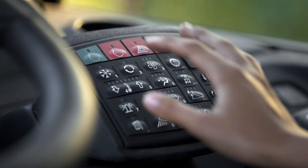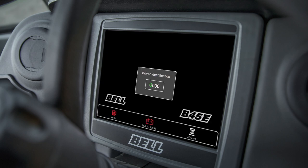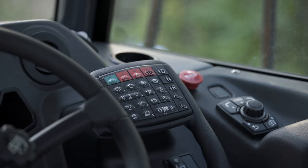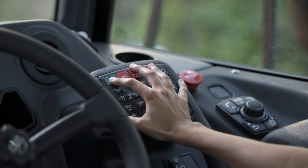To start, press the green button on the SSM. This wakes up the CDU. Enter the security code — the default setting is the last four digits of the VIN number, but up to eight personalized four-digit codes can be assigned to different operators. Press the green button a second time to start up the engine. The horn will sound twice.